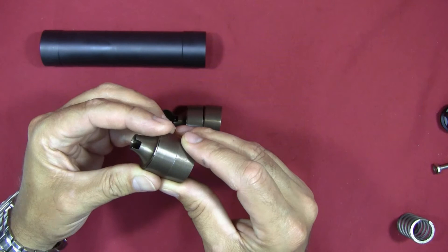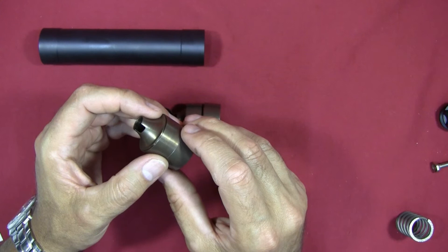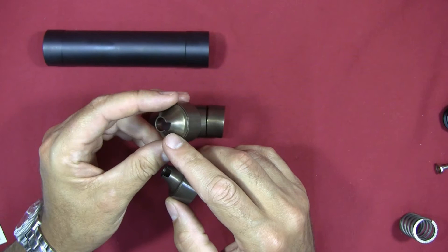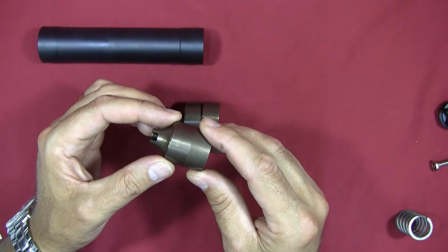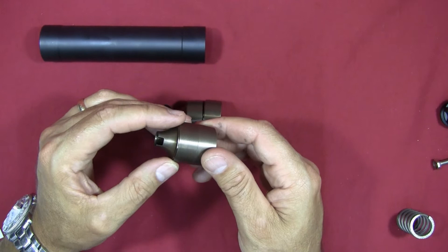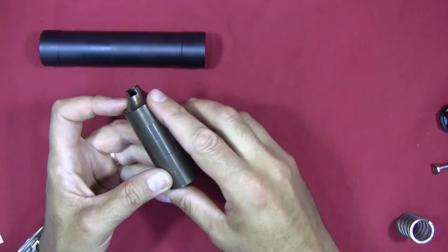Of the five large baffles, there's a dimpled area that protrudes out on one side and nests into the next baffle on the other side, so there is a specific orientation required for reassembly. You can hear them snap into place when correctly aligned. According to the assembly instructions, you need to ensure the slotted ports are all aligned — meaning in a row — to get maximum silencing capability. It is possible for the ports to be 180 degrees out of phase, so make sure they're all aligned.